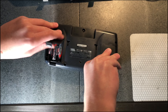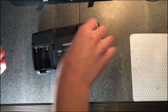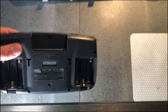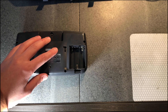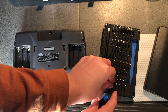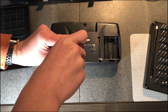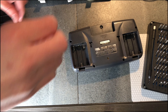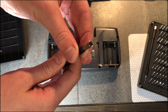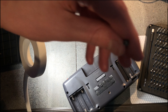Let's open it up. The first thing to do is take out the batteries. The screws in here are Phillips, and then there's the game bit. You can see someone has already been in there and stripped it all out — that wasn't me. I checked if the capacitors were bad before. Using my iFixit toolkit, we'll remove the Phillips head screws first, then the game bit head. It's a little stripped and hard to get on, but it comes off easily and I can open up the Game Gear.